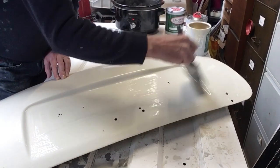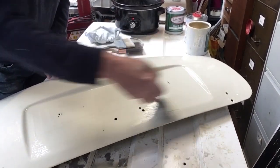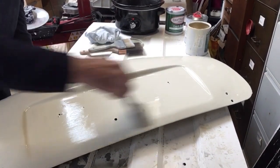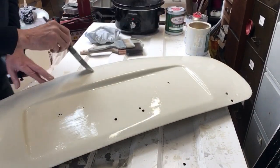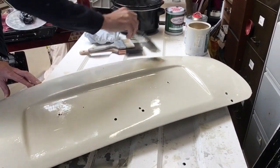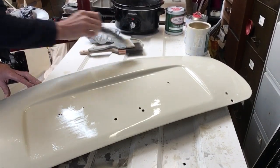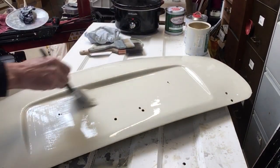If you're doing bigger panels, the only thing you've got to do is keep the paint warm. After doing this boot lid, if I'm going on to the bonnet, I won't leave the tin out — I put it back in the heat to warm it up; it makes it flow easier. Plus with the additive, the PPA additive, it makes it a lot easier. You just brush it out and feather it across — they used to call it tipping years ago, but most decorators call it feathering now.